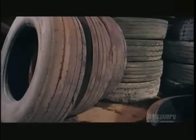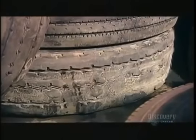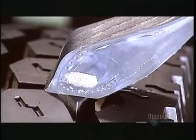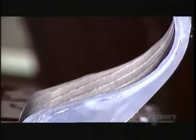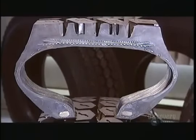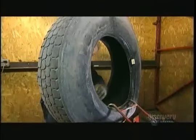This company specializes in remolding commercial truck tires. The worn-out tire is called a casing. This is a cross-section. That steel reinforcement rod, called the bead, won't be replaced. But most of the rubber around it will be, along with most of the tread area. The steel belts underneath the treads — those dots — will remain. They begin the remolding process by thoroughly inspecting the casing to determine whether it's indeed salvageable.